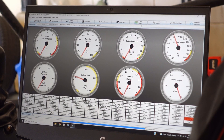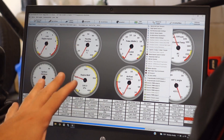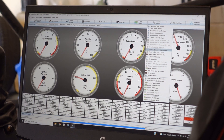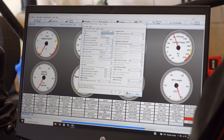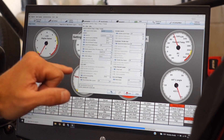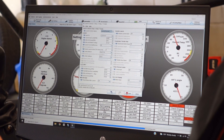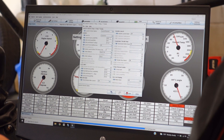Once you've got your switch wired up, we're going to go to Advanced Engine — this is in the latest revision of Tuner Studio software — then we go under Launch, Two-Step, Three-Step. Now the way that we can set this up is the launch control option can either be off, it can be launch, or it can be flat shift and launch. The way that I've been running it was just launch. When you're on launch, the other options for flat shift are not available. So we're going to change this to launch slash flat shift, so we're actually going to be doing both from the one switch. Hard launch is going to be our RPM limit. For launch, I've got mine set to 4,800 RPM.